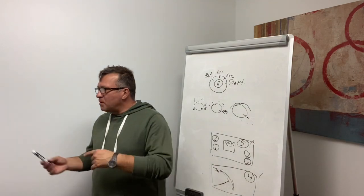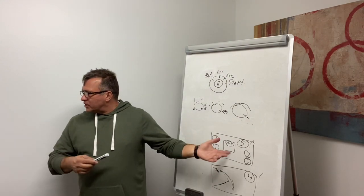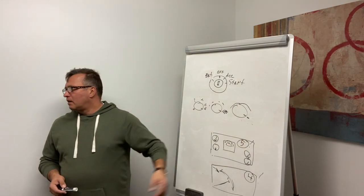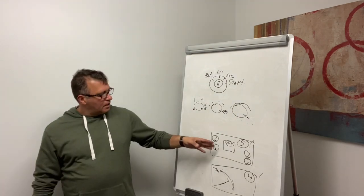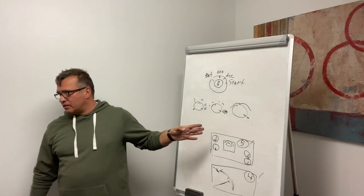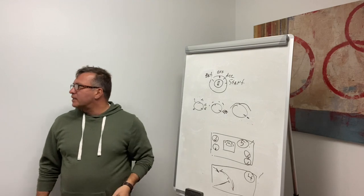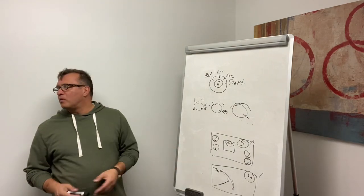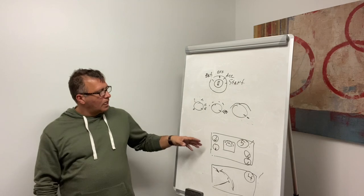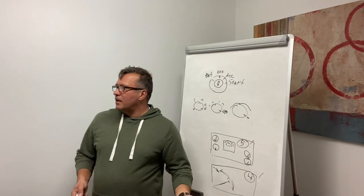Okay. We build up pressure. If you hear the sneeze, that indicates my governor cut out, and the pressure was built at 120 to 140 PSI, which indicates that my air gauges, primary and secondary, are working properly. Now, this is my oil pressure gauge, not oil temperature, please. The warning light is off, it's rising to operational range, which indicates it's working properly. This is my water temperature gauge, rising to operational range. Warning light is off, which indicates that it's working properly. This is my voltmeter. It's rising, which indicates that my alternator is charging.